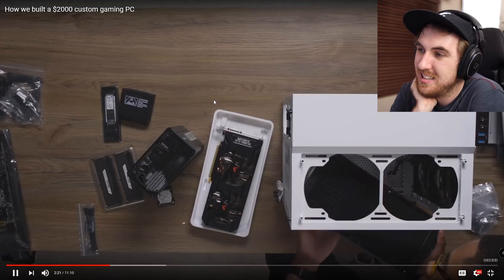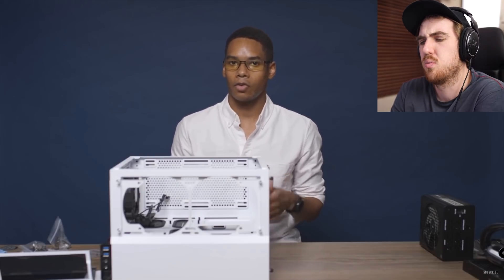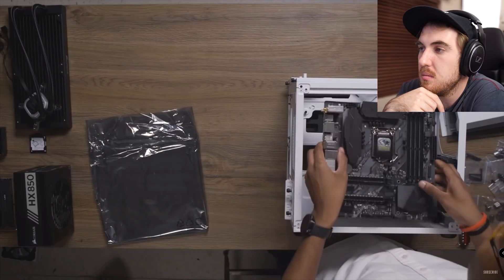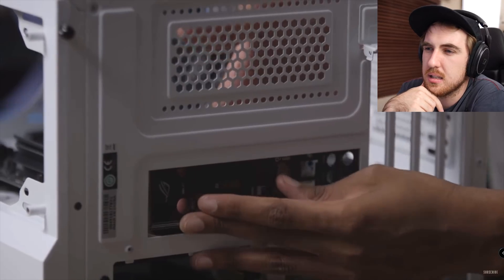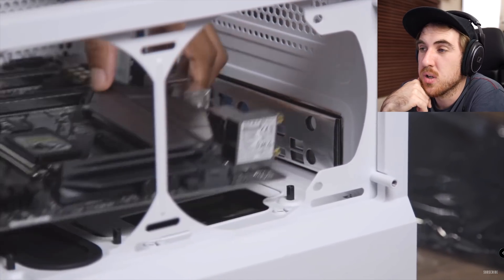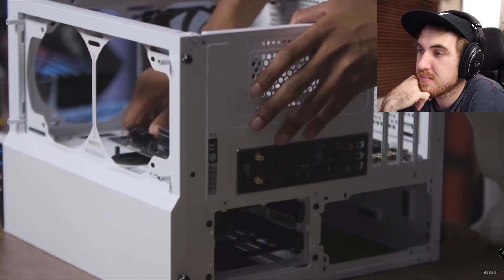Okay, I will get into that a bit later. And now I'm really going to start building by adding the motherboard in. Some notes about installing the motherboard — it's one of the cool new Corsair cases. Also, don't screw in too hard, otherwise you could crack the board. You have to really turn it in hard to crack the board. And also it has support for NVMe SSDs, meaning you can get really fast SSDs that are really easy to install. A lot of motherboards these days have the brace that goes at the back of the computer. You always have to make sure that you've really hammered it in because there's no screw — it really just has to go outside of the case. That's a new word for it — I'm going to use that from now on. This is very important because otherwise you can't align the motherboard correctly with the holes.